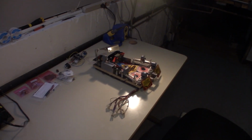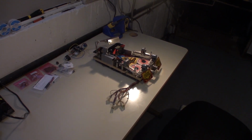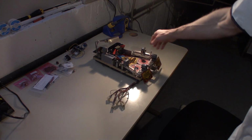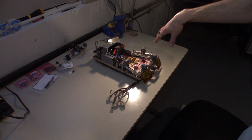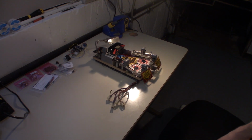The Mini-Playfield on this game actually isn't that bad to work on, but basically all we're gonna do is start taking all the plastics off. We'll get the street lamp off, and then we'll replace all the star posts here and all the rubbers here. We'll clean the playfield, we'll wax the playfield. So yeah, just pretty much the same as everything else we've been doing. Just gonna start with this.